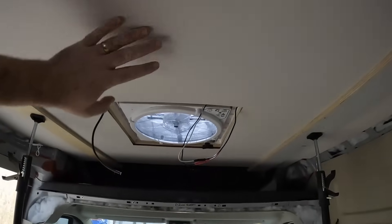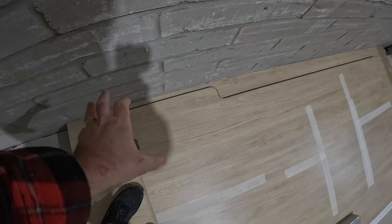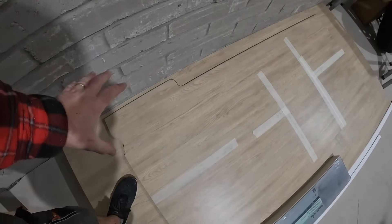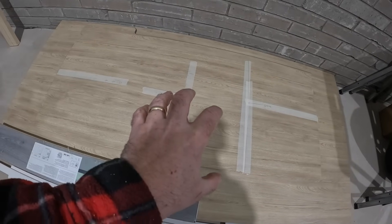While the silicon's still wet, I'm going to put the MaxFan surround on — like I did on the rear — because it's another job finished, but also it will help hold that panel up in place as well, so there'll be plenty of support on this. Now I know the bulkhead fits. I've just done the top trim on it. This is the driver's side where the kitchen's going to be — he wanted it straight but also wanted the rise to be quite small. I've done it so it's going to be about 100mm above the kitchen worktop, just to give some protection to the bed.